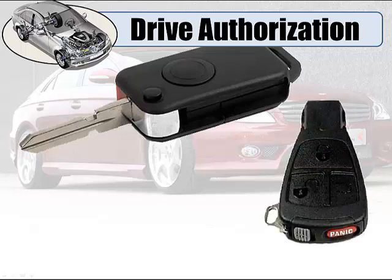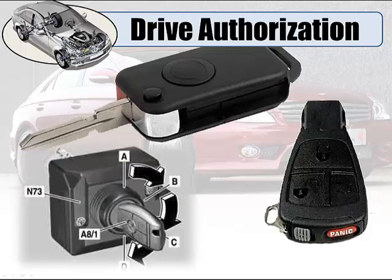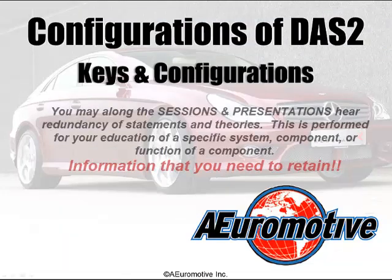Since there is no mechanical blade for the DOS3 version to unlock the ignition switch, the release of both the ignition switch and the steering column itself is performed electronically once DOS validates the key through the infrared data exchange. And then the key can turn. Remember keeping that lens scratch-free and polished? That's what we're talking about.